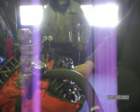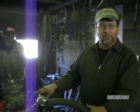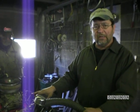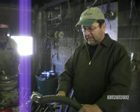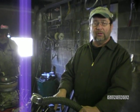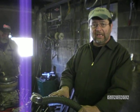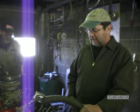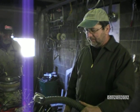Yep. Good. Now if you're looking on the push rod side of it, they only move about 200 to 250 thousandths, which is about a quarter of an inch. That means it's about a 400 lift cam, in around there. And even the hypo cams that were in these solid lifters, they were only 415 lifts. So they all went up and down even. That's a good sign. And if you didn't think they lifted high enough, that's because they didn't have much lift in 1959. So everything looks good.